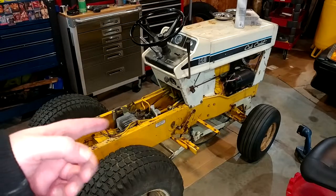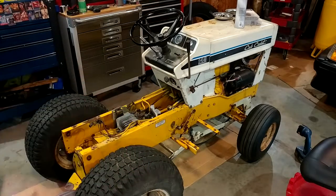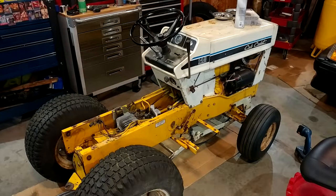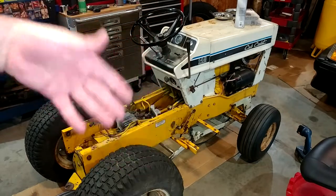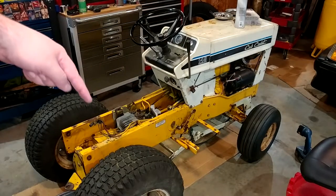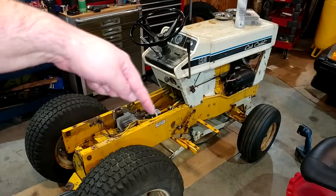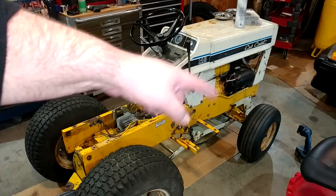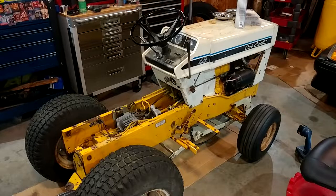One such happening was I just had to split the tractor to reseal a transmission leak. As such, the fenders and stuff are already off of it. At the end of this video I'll show you how to put them back on, since the procedure is the same both ways. What we're here to do today is replace the main power harness, which runs right along the frame and then up to the starter relay and over to the starter, because mine is not in very good shape.